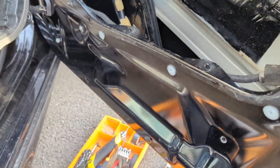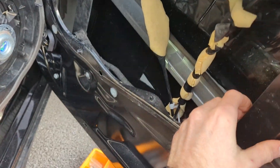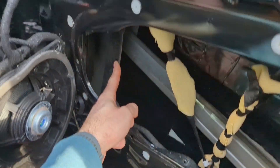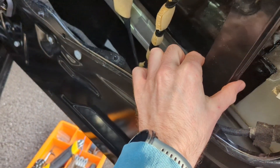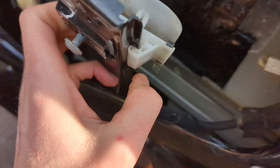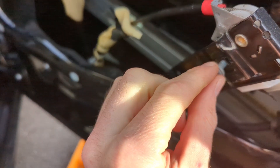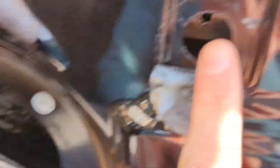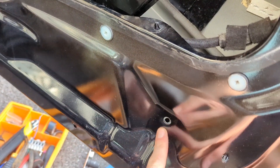On the inside it really is quite straightforward — just take your time. Move that arm out of the way; it's not attached to the window. I think there are two clips on the front window. There's a bracket there and you can see that white thing — you have to push that out of the way to release it from the hole in the window. There's a screw here that goes into that bit there, and there's another screw at the bottom. That's what holds that bracket in place.